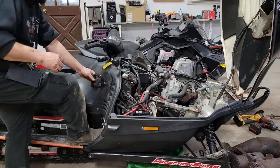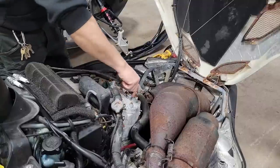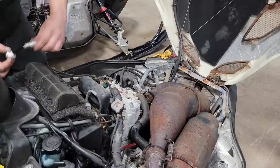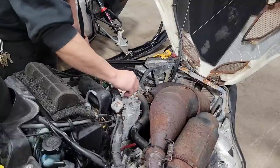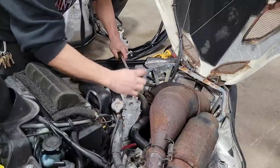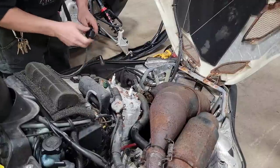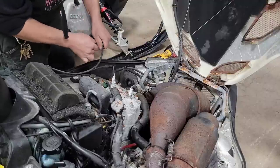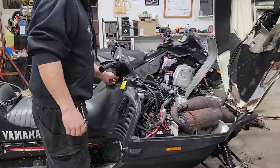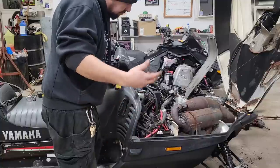We've got a working pull cord and the exhaust is all back on. Now let's swap out these BR9 plugs. These ones don't look like they were burning too bad, but I've got some fresh ones — gapped them already, anywhere between 28 and 30 thou should be fine. Cinch them down, don't have to go crazy with the torque, just crush that gasket and then a little bit more. Before we stick them back on I'm going to wrap that chafed wire with a bit of electrical tape — electrical tape fixes everything. The battery's dead so let's see if the electric start works.